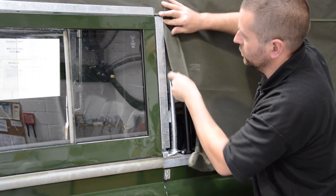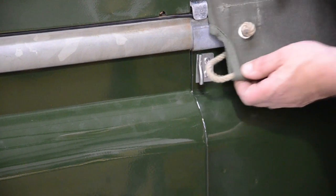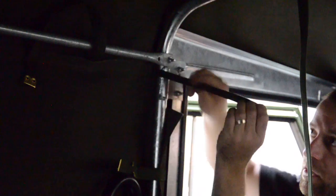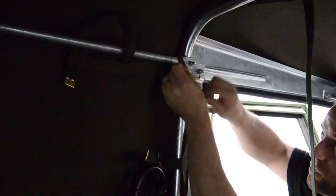Make sure the rest of the hood goes into the side door channel — it should go right down to the body mount. This tab folds back through between the rail and the side door drain channel, goes through and then buckles back inside. This is the flap we pushed through earlier — it goes around the bar and into the buckle, not pulling it too tight at the moment because you have to take up the canvas to the back of the car. The tab that comes through the over-door drain channel wraps over the front screen header rail top bar and just gets tied off, pulling it tight.